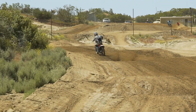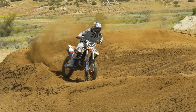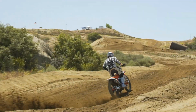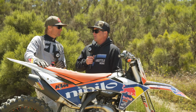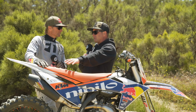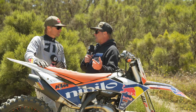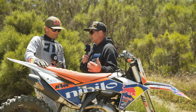Do you think that'd be a good advantage? Say I ride track, I'll be going down to the Sacramento area, East Street, maybe Prairie City, but then I go to Mammoth, that big elevation change. Is that a time when I'd use that map tuner? Absolutely. So I'm going to send you home with this thing. I'm going to connect you with Paul and have you guys work on it, okay? He'll probably send you a different spec for the exhaust that we put on here, and then tell him, hey, I'm going to Mammoth. What kind of mapping change should I make for 7,000 feet or whatever it is there?